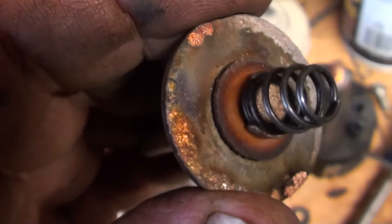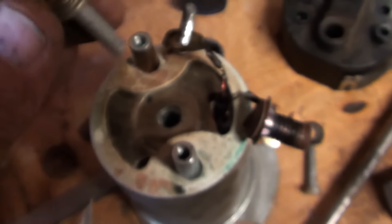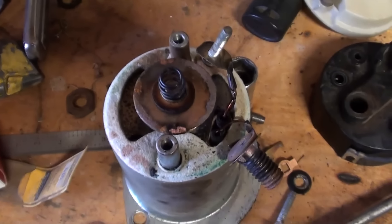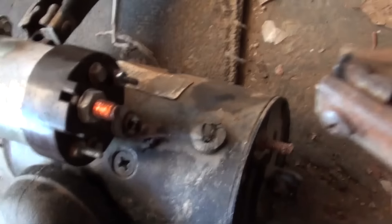This also translated into poor contact on this washer, because I've never seen one cook like this before — seen plenty of arcing, but never seen one cooked. That's one of those things where somebody's cranking and it's going rrr, rrr, and they just hold the key on and keep going, and you're standing over on the side of the parking lot going, IT'S NOT GOING TO START! So when I yank my charger up to the 235-amp starting zone and you hit this, not only do you get a blinding flash of light.